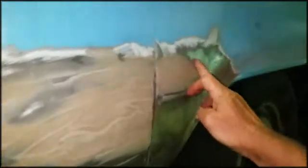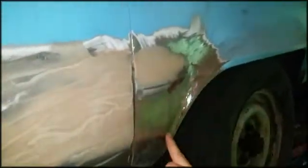These are the windows I've welded in. I've only ground a little bit, I haven't finished grinding it yet, and I'll put obviously just a little bit of bog on it. Here, there's that strip, I've got to spot weld back onto that. The strip that actually holds the cover that goes along here. You see here too.